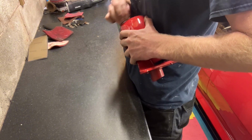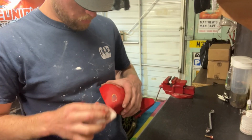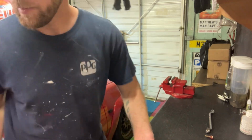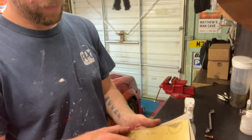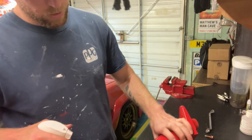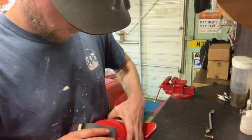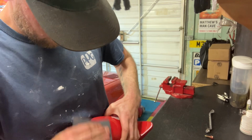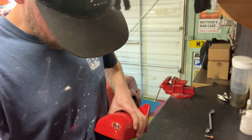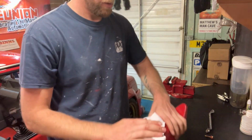Give the chipped edge a little blast over with some 180 grit sandpaper first of all. Onto a 320. And some water in my spray bottle. Spray on the area for some wet sanding. That's perfect. I can't feel that whatsoever now. Let it dry off.